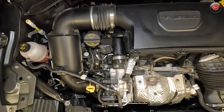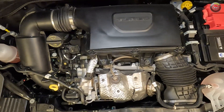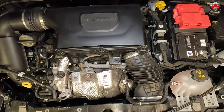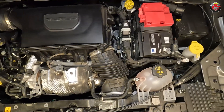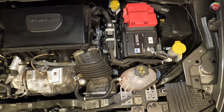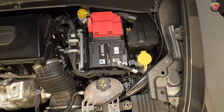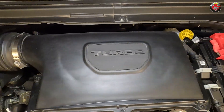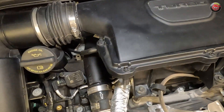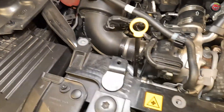The layout of the engine compartment is a little bit unique, with the turbocharger at the front of the engine in plain sight — easy to burn your hands on. Then there's the air filter box, which actually sits high on top of the engine itself, taking up ample space afforded by the tall SUV's profile. Following the airflow, the intake charge starts through a snorkel at the top of the radiator and travels back into that large air filter box mounted on top of the engine. From there, it travels through an ornate plenum tube into the turbocharger itself.